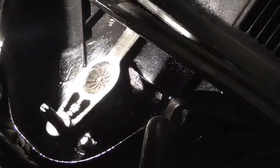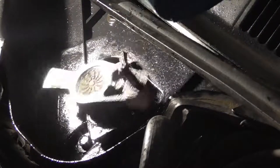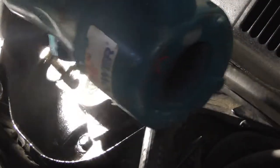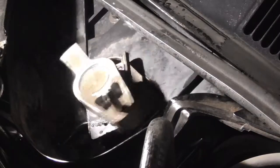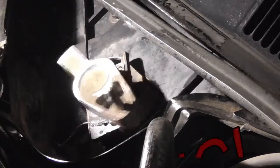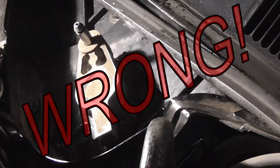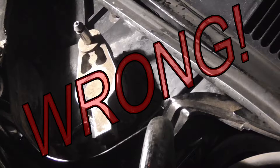Normally, when you turn off your wipers, you will notice that they fall to a lower level and park themselves. This is accomplished by a simple catch-and-pull action between the armature rotor and the plate below it. After it's been cleaned, you will see the incorrect way for the rotor armature to stop — this would leave the wipers in the full up position after turning them off.